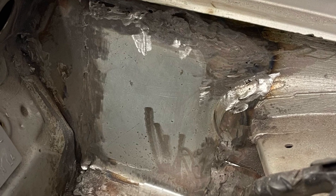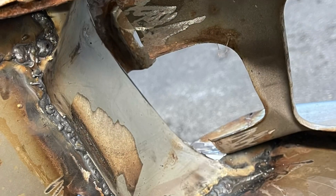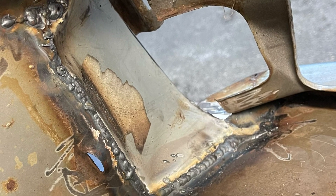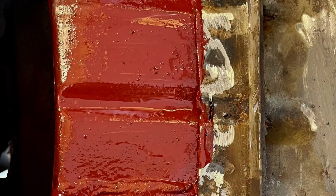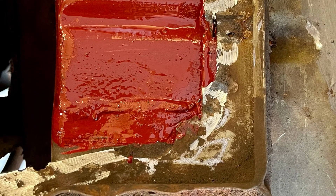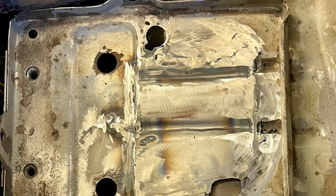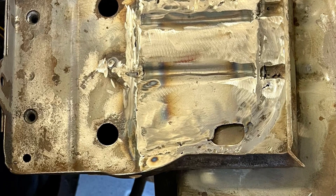Now the wing is all repaired with a new piece of metal in - a bit awkward but worth it to get the results without taking the whole wing off. The next bit was the battery tray. I had two little holes in it, however on further investigation I ended up cutting most of it off and remaking a new piece. I believe these can be obtained, but again I like to repair my own - one, it's the original still in the car, and two, it gives you a better sense of achievement.